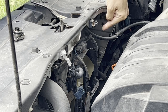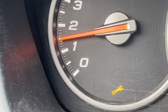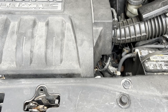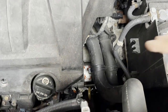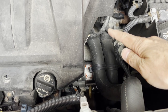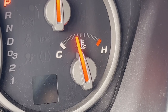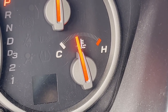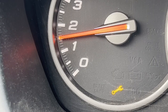There are two fans — one here and one here. Make sure the heat is set to maximum. Start the engine and rev it to 1500 RPM until the radiator fans come on twice. You can't hear the fans turn on and off over the engine, but what you're waiting for is for the thermostat to open. To check if the thermostat is open, feel the upper radiator hose — it should be hot since the thermostat will allow hot coolant to flow into the radiator. Make sure the engine temperature doesn't go much above halfway. An air bubble near the engine temperature sensor could cause the temperature to spike momentarily. If the engine temperature does remain high, shut down the engine and wait for it to cool before proceeding. I revved my engine for five minutes for step one.